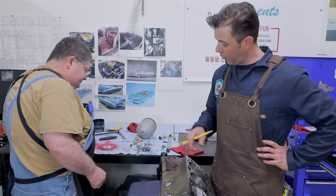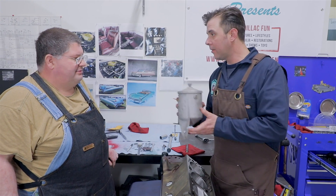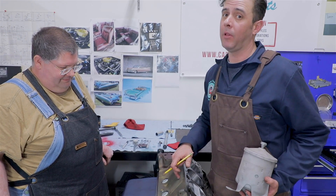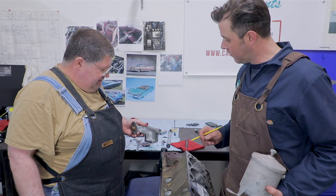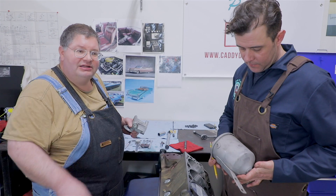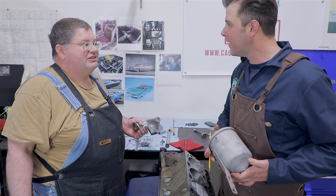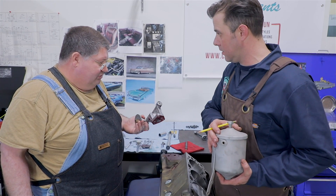Here's where we're going to put the oil filter on. What's very interesting is that in 1959 they used a canister style bypass oil filter. This block, which came with the convertible that we have, is actually a 1960 block. In 1960 they went and relocated the oil filter over to this side and went to a full flow system instead of the bypass. So what we're going to do is have the full flow system because it's absolutely necessary to get the oil to flow where we need it. And we're going to also mount the bypass when we do the accessories topside, so we'll have dual filtration like they do on a lot of big trucks and diesel engines. We're actually going to end up with the best of everything — full flow filtration and then the bypass to pull out the smaller particles. And what's great is it'll still have that aesthetic of looking just like 1959 on there, but with the added benefit of full flow filtration.